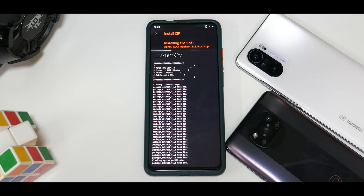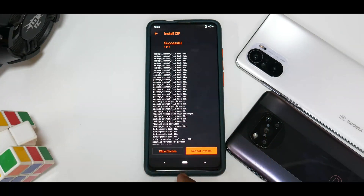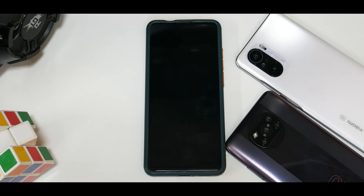The ROM has flashed — just make sure you haven't had any errors or red-colored warning signs. At this point you can go ahead and flash Magisk, or flash DFE — it's completely up to you. For me, I won't be doing any of those, so let's click Reboot System. As I said, the first boot will take anywhere between three to five minutes, so please be patient. The only thing you'll see during first boot is the ROG boot animation, which in my opinion looks great — but it's not something you can watch for five minutes, so just go do something else.